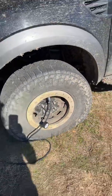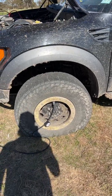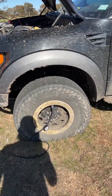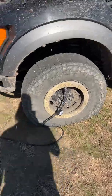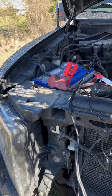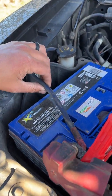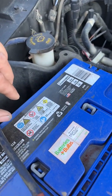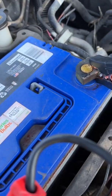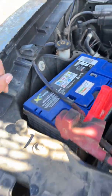I've got it hooked up and I'm going to test it out real quick to see how long it takes to pump up a 35 1250 17 tire. I'm going to take it up to about 35 psi, that's what I run in this truck. I've got an X2 Power battery here — 930 cold cranking amps, group 65 AGM. It's a pretty serious battery, about 300 bucks.